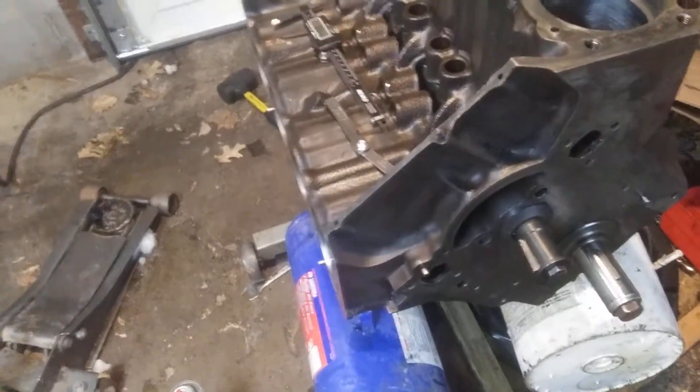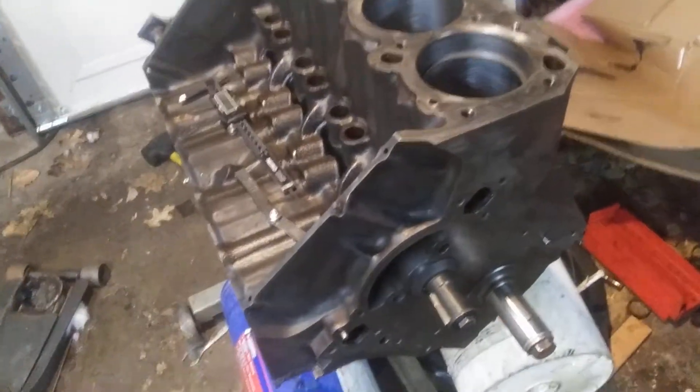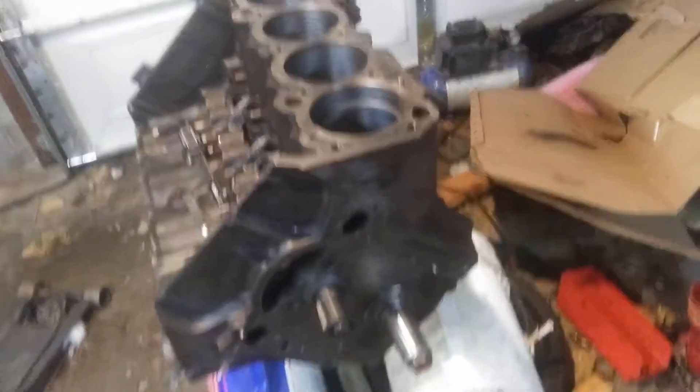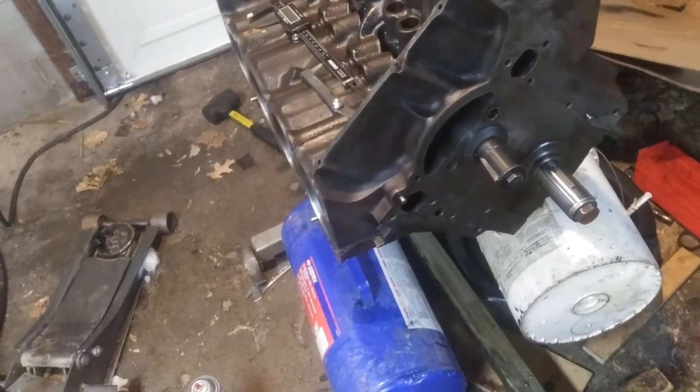I have just been in here the past couple months on and off, building a new Buick 350. This one is a 71, so it was the first year of the low compression 350s. This, I believe, was about eight and a half, maybe nine to one. It was a two barrel, so I think it's probably closer to eight and a half.